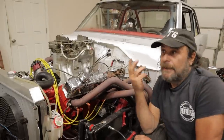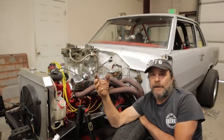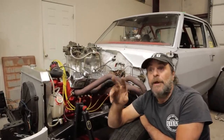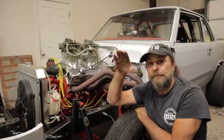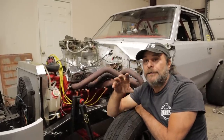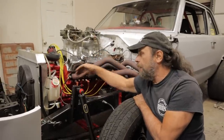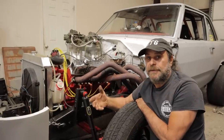That's where the magic happens - that's all camshaft timing. All camshaft timing is based on that overlap period. If you're advancing or retarding a camshaft, you're moving the overlap period forward or backwards in relation to the piston position. If you've ever taken a regular engine and tried to run it with no exhaust system at all - no manifolds, no headers, no nothing, just a bare port - you'll see you can barely even get the thing to start.